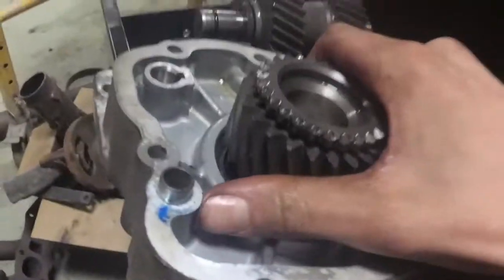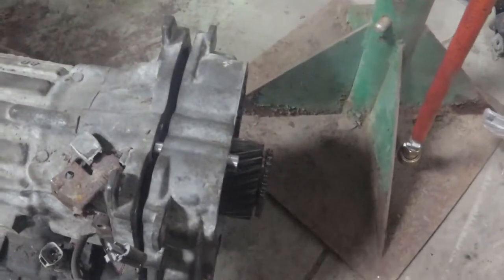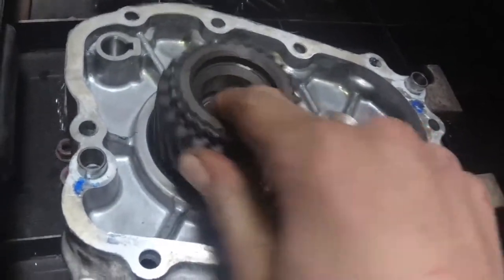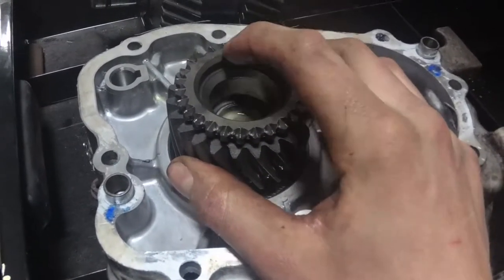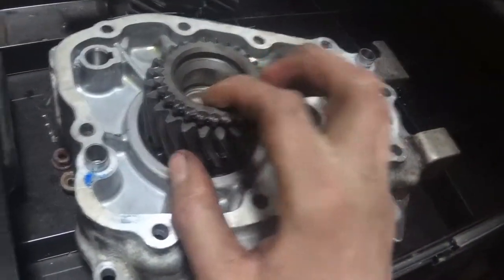Well anyway, this has the bearing and everything. Basically, the idea is this part works fine — that will slide all the way onto there and we have ourselves a gear, something to deal with on the back of the transmission. This bearing and seal for the transmission will be all fine, just like it had a transfer case. But we need to get this hooked up to this. The original plan wasn't going to work — we're not going to be able to machine this because it's really hard; it's hardened.